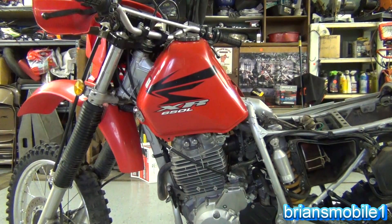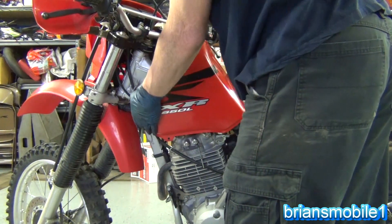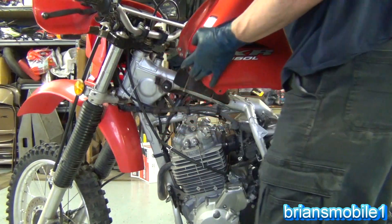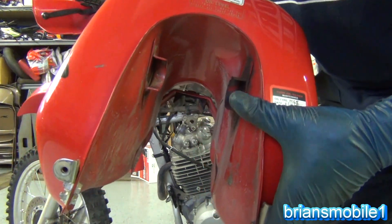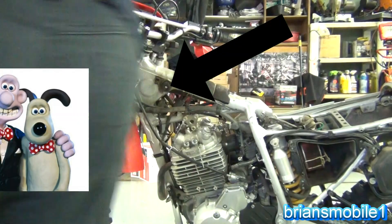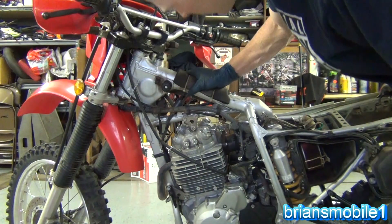At this point you're free to take the gas tank off. I usually grab it up front and back here so I'm at each corner. Slide it back and take it off. When you look in there you can see it's got two little things on each side that go onto grommets. You don't pull it up — you pull it backwards and it'll come off. This one's got a custom pad here.